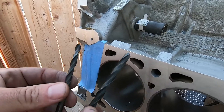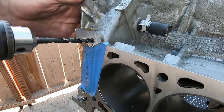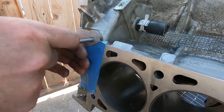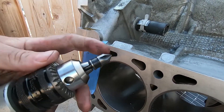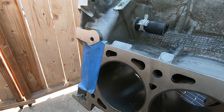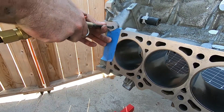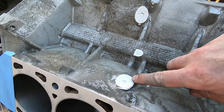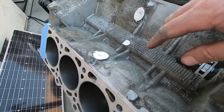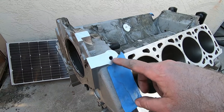I'm going to go incrementally higher until 5/16ths. Then I'm going to file these edges in there a little bit. Lastly, I'm going to hit it with this little countersink to give it a bevel, and blow it out real good. Now you can see how the block has been modified — these nubs are gone, and there's also a hole drilled in here for the two-valve heads and later four-valve heads.